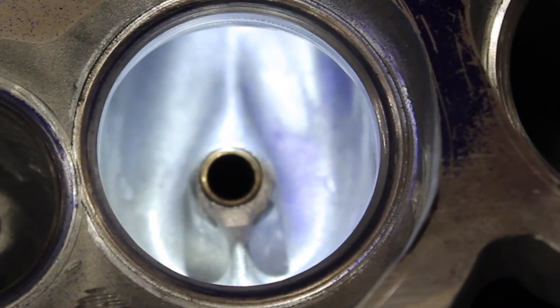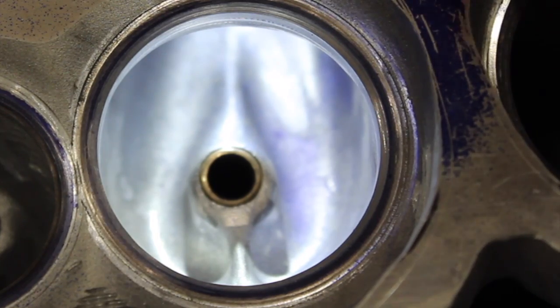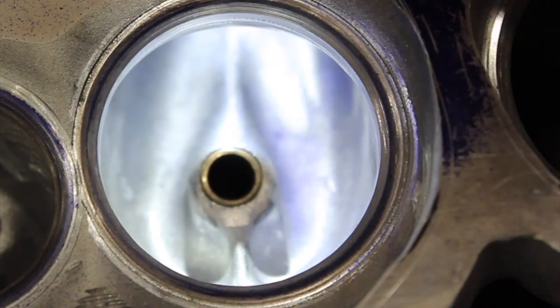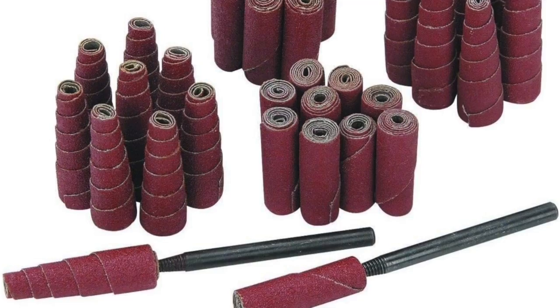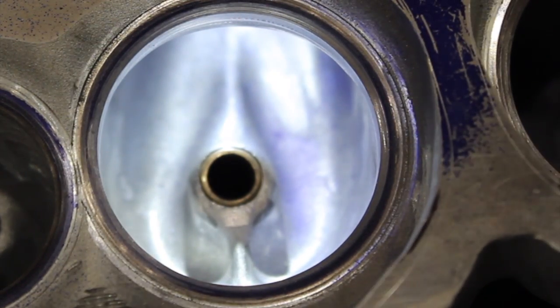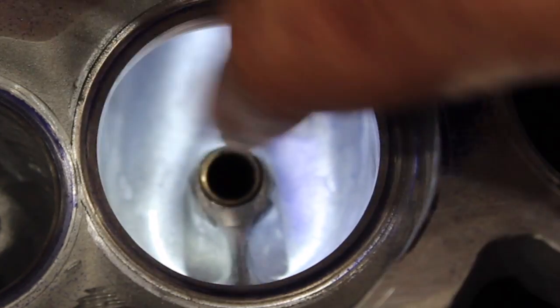Other than that, all we're really going to do is clean up. You'll notice with these cheaper castings that they can be kind of slaggy and the casting inside will have a lot of rough spots. So basically all I did was just knock those rough spots down — take a 60-grit sandpaper roll and go in and just clean everything up. Didn't reshape anything; the vein and shape are all the same. Just cleanup in the throat, the bowl, and the runner. The slag is gone, and we're also going a little bigger with the inlet opening for gasket matching.